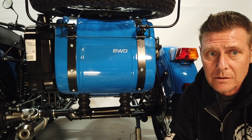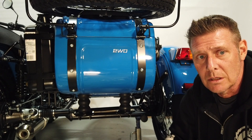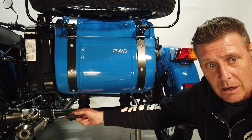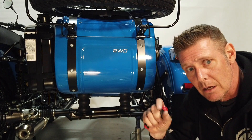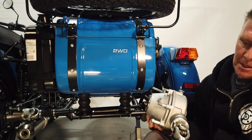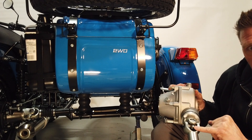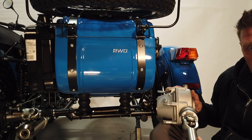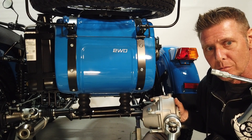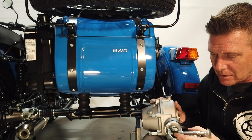To address the question from Terry and Mike on Facebook: if I'm understanding correctly, you were curious about the greasable u-joints and where the Zerk fittings were on the bike. On a one-wheel drive you're only going to have one, on the main drive shaft from the gearbox to the final drive — there's a little tiny u-joint in there with a Zerk fitting right here on the yoke. That's pretty hard to get to with a standard grease gun because the tip is too big, so what we use is a little pointed-tip tool that you can press right onto the Zerk fitting and fill it with grease.